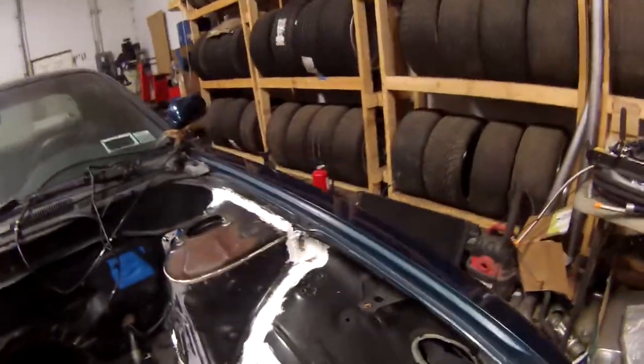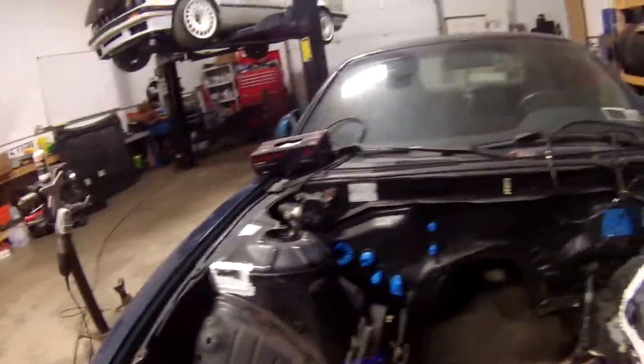What I just finished doing was the long, annoying, and painful process of seam sealing the parts of the engine bay that I welded — the parts that were cut out for rust. So on all the seams of everything that I replaced, there's a rubber sealing liquid to make sure that it's waterproof and stuff like that. Once primer and paint goes over it, it won't be as jarring as it looks now. I'll let this dry overnight, and then tomorrow I'll prime and paint it.